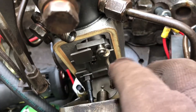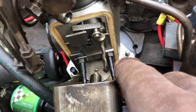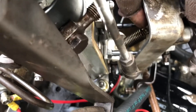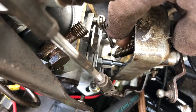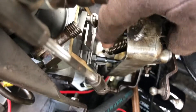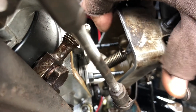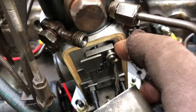After doing the timing marks, I opened this up and was wondering if the governor is in the right place. I posted to the Land Rover Series group on Facebook and a guy confirmed yes, it's in the right position. See that little arm right here — it connects to this spring, and this spring connects to this plate, so you can adjust where your governor kicks in by RPMs. It's sitting at the right position — the middle hole and the bottom hole. This piece connects to your actual throttle and moves this arm up and down, which has the governor attached to it.